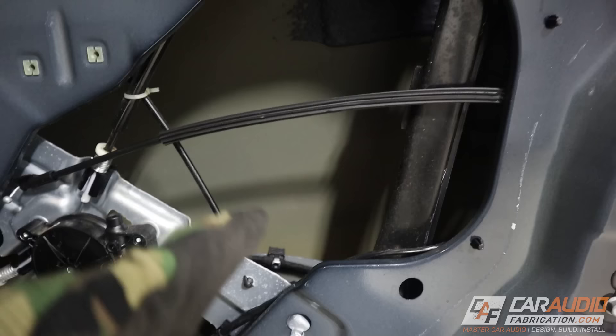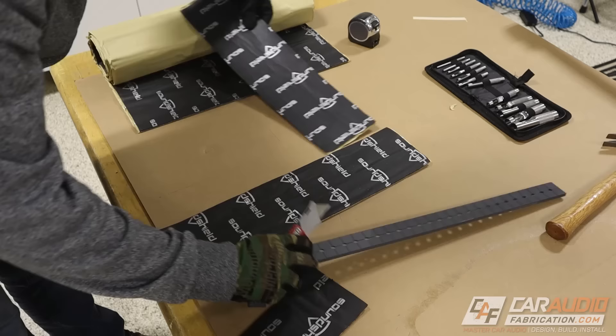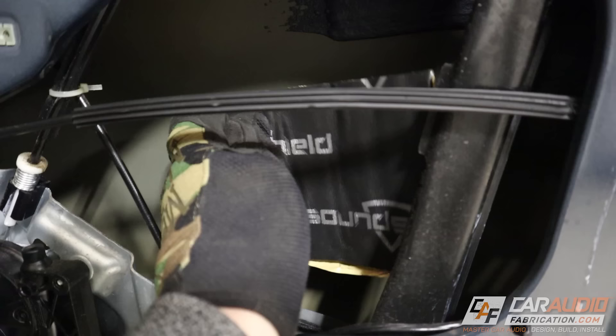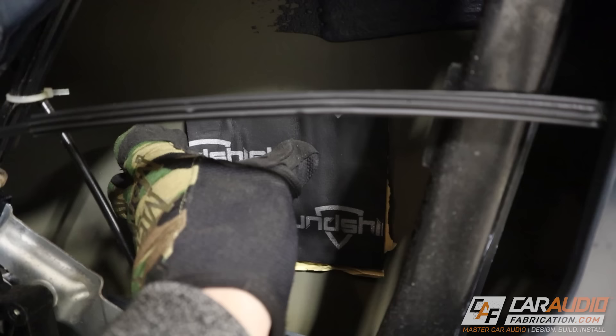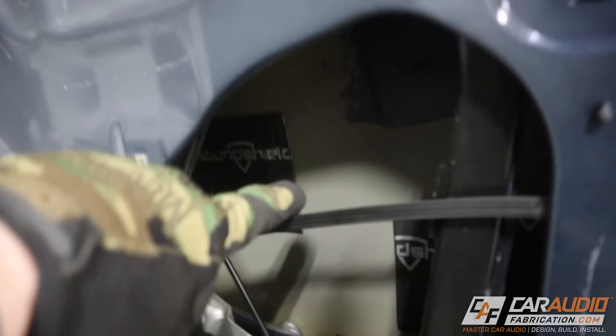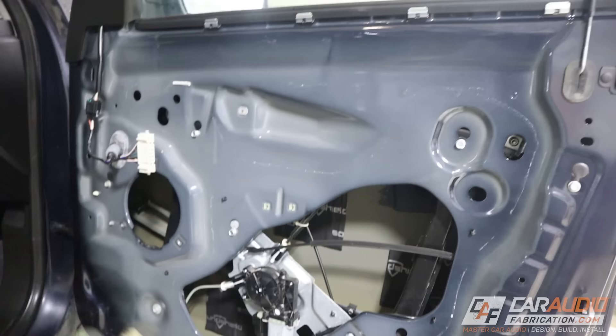For sound treating this first area inside the door cavity, I'm going to use a bunch of squares that I've cut of equally spaced material. I like doing this because you only have a limited amount of space to actually get material inside the door. For this project, we're looking to make the most efficient use of materials, so having about 10 of these tiles on this inside door skin spaced out evenly, and a couple more focused directly behind the speaker, is going to provide a great result. We've treated the inside cavity — I put down 10 tiles. Now we need to turn to number two: doing this inside door skin.